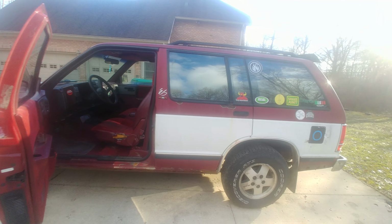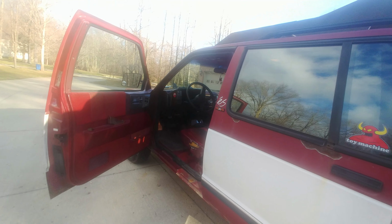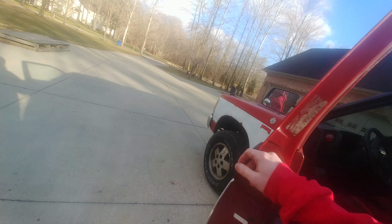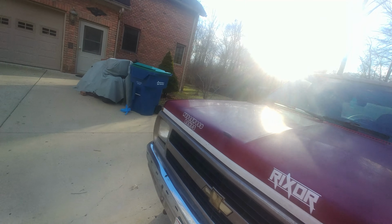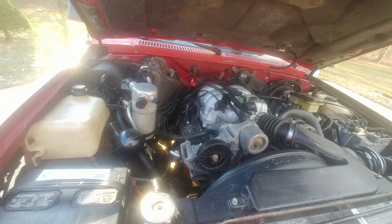And it did. Made it down the highway. Wasn't running real good, that's for sure. Had bad compression. It was misfiring and a whole bunch of smoke coming out the exhaust pipe. And well, turns out the head was going, and it was because of road salt. Actually, it rotted from the outside in. And well, full rebuild.